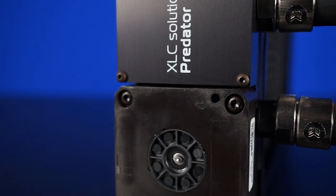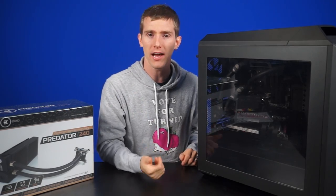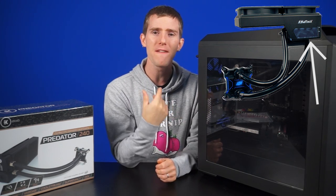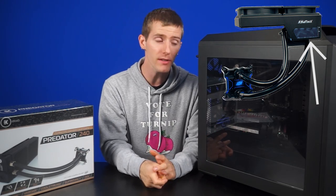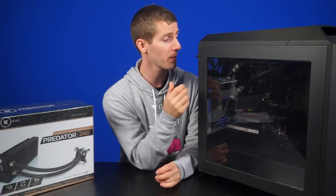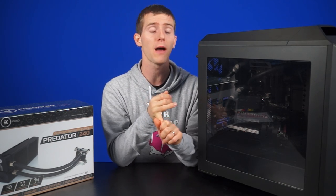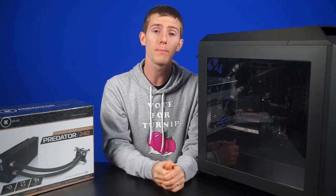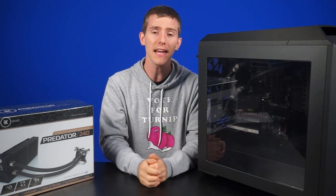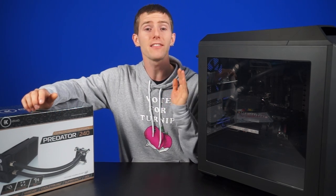You can see the pump and reservoir are both in sort of the tank end of the radiator in order to try to save some space. We've seen similar designs with Swiftech, but that had the pump and reservoir mounted in one of the fan mounts, which added a lot of thickness and reduced compatibility to a greater extent than EK has done with the Predator. Obviously a lot of other folks put the pump on the CPU block, but there are some patent concerns with that, along with issues where having a vibrating object on top of the CPU transmits more noise through the motherboard into the case. So the one thing to watch out for with the Predator is you need to make sure your case has enough room.